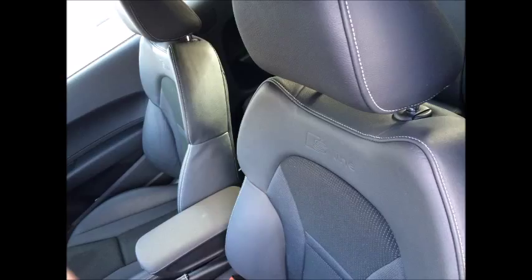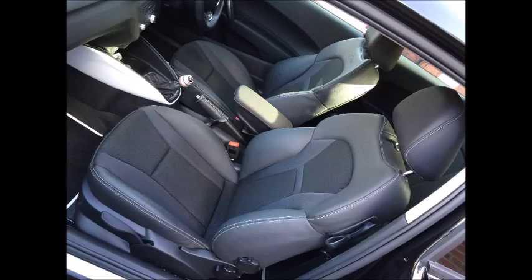The only other thing I would say is with the airbag connectors, obviously don't worry too much about it. Take your time with it. Don't force anything. If it's not coming out freely, it's because you've not pushed in the little tiny back plastic bit enough to free that connection loose. But other than that, it was quite an easy job. The looks are fantastic. Seats are great. Just find yourself a nice bargain somewhere.